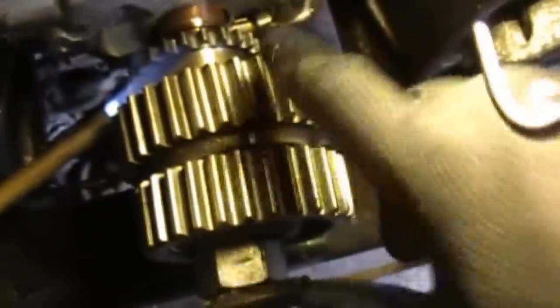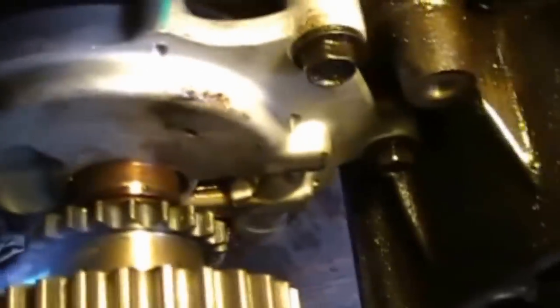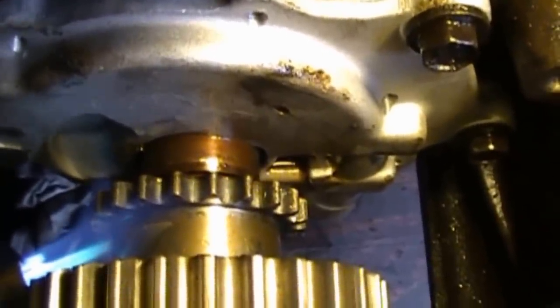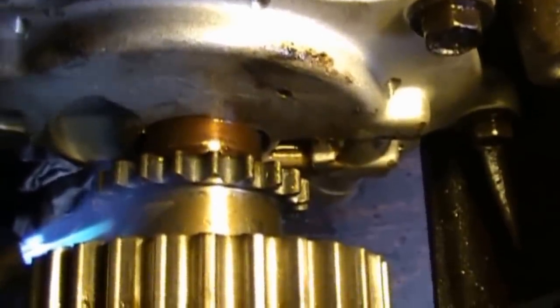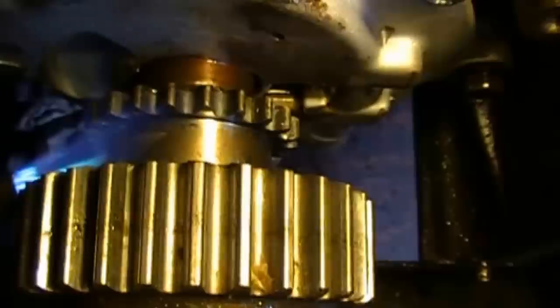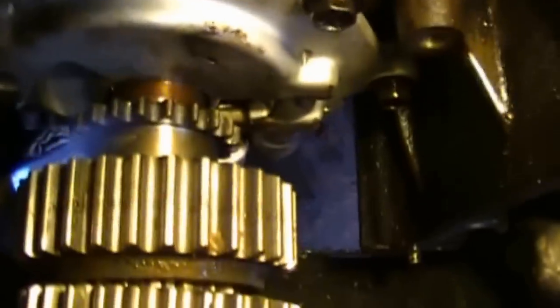I'm going to show you how to install the crank gear. I've got my torch on the gear down there at the bottom and what I have is an old sprocket. I ran a bolt into the crankshaft and all I'm doing now is turning it to tighten it up and push the gear on. I've got the cylinder locked up too. As you watch, you can see the gear going on slowly - trust me, the heat makes a big difference. You can see it's going all the way on, slowly pushing back in there. That is the hardest part of this engine - everything else is going to be a piece of cake.